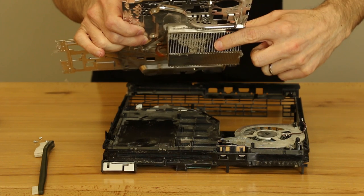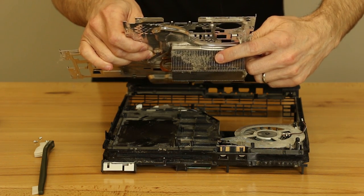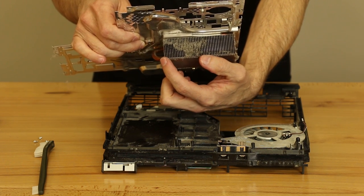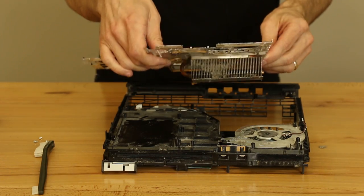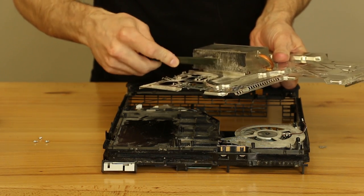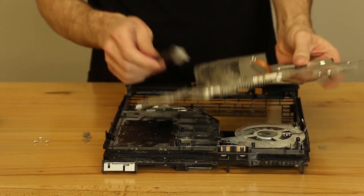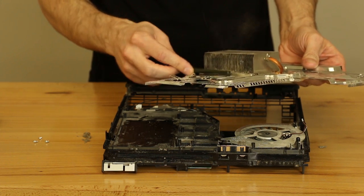You can see right in there, there's a bunch of fuzz in the heat sink — this is the part that most people don't clean when they clean their PS4. This one doesn't have a lot, but it has enough that you can see it. In PS4s that overheat and get super hot, this sometimes will be almost completely plugged, usually mostly on one half of the heat sink because of the way the fan rotates. To clean it, use a brush like this — get the bristles in there and brush upward. You don't want to push the debris down further into the heat sink.